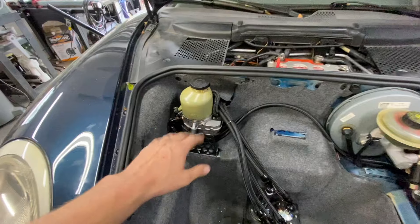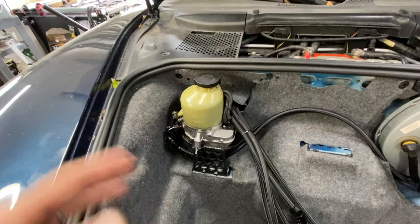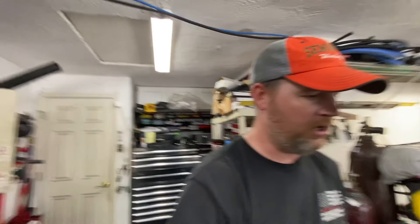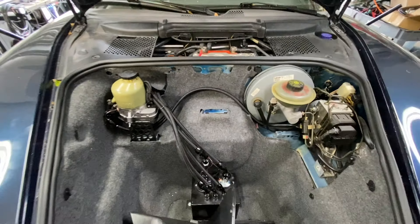This pump was also offered in a couple of European cars — Opel Astras, for example — which makes them relatively affordable. I get all these pumps from Europe. They are remanufactured: taken apart, media blasted, aluminum cleaned up, resealed, electrical components replaced, then sold as refurbished units. I bought seven and my European contact has 50-plus in stock, so there's no shortage. Right now I have seven in stock. Installation is simple: drill two five-eighths holes for the bulkheads, one hole for the bracket, and everything else is bolt-on.